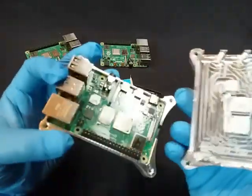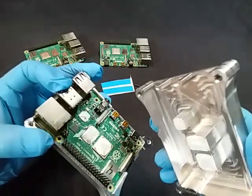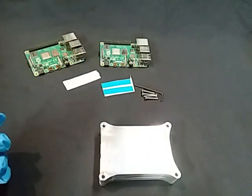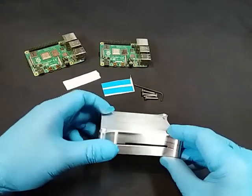If it spread on all of them — which it looks like it did really good — that's exactly what you want. If it didn't spread far enough, go ahead and put a little more on there. If it's spread too much, that's okay. Heat sink compound is non-electrically conductive, so it won't matter. It'll only transfer the heat — it won't short anything out if you spill some on the electronics.